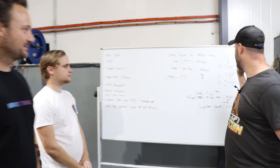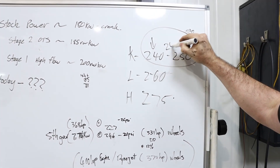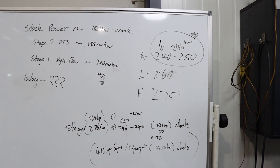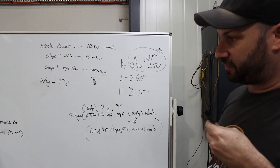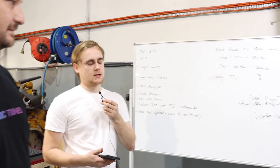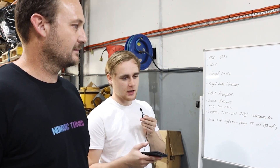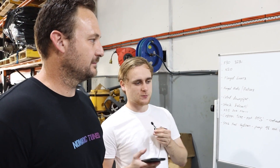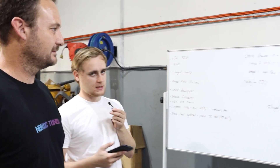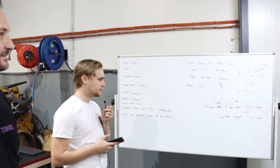We've got a result — it looks like Ken's won this one. He went 240 to 250 and we've hit 246 kilowatts today, which is about the cleanest and best we can get it to behave with our current fuel system. Harry will now explain the near future upgrades. Today we hit a snag at 5,000 rpm — the high pressure fuel pump completely dips as it can't handle the airflow the turbo is supplying. We'll need to come back with an upgraded fuel pump like a spool FX-150, or even port injection depending on budget. That should get us into the 260 kilowatt range on 98 RON, and on E85 probably 300 — but we'll have to find that out for real.